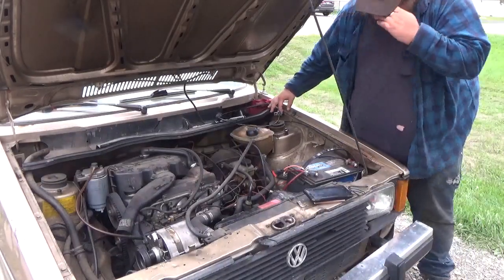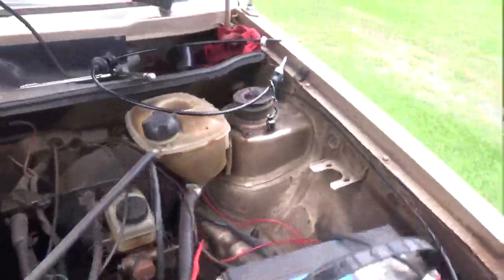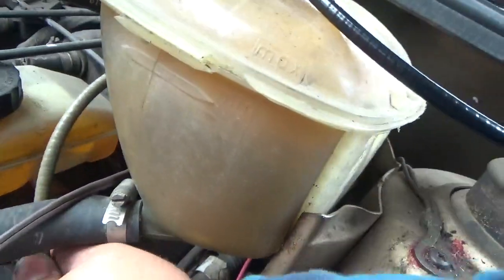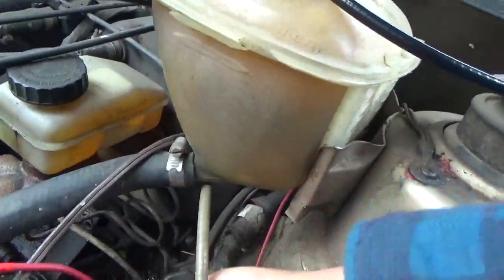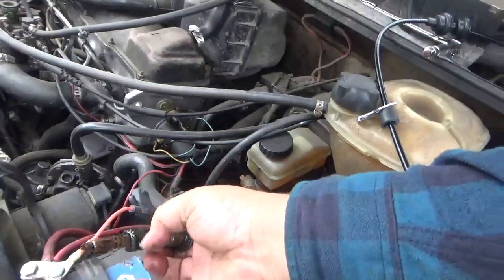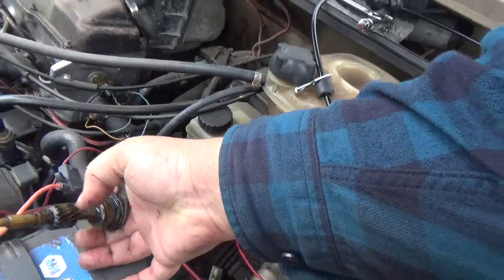Speedometer cable. Now I'm gonna probably start us off in the interior, because realistically folks, all we gotta do here is take this bolt out of the transmission down there, and then the entire cable assembly should come out. And now it only has one gear. It does not come with a gear, so you have to transfer over your old gear onto the new speedo shaft. That is one thing that if this is broken in any way folks, that you have to do.